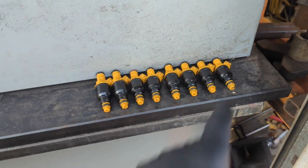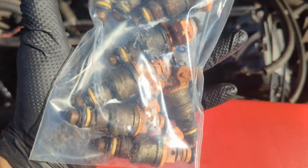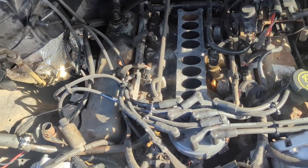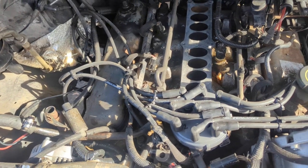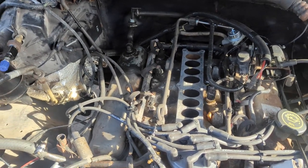There's the set — all removed. Number eight was stuck wide open. So I got the original injectors that came out of this engine that I rebuilt earlier this year — they're going back in. I'm gonna climb back up in here, set the camera down, get these things in and hopefully get this thing back up and running today.